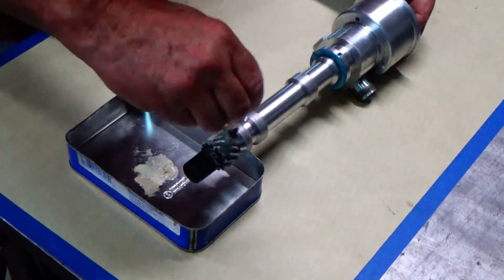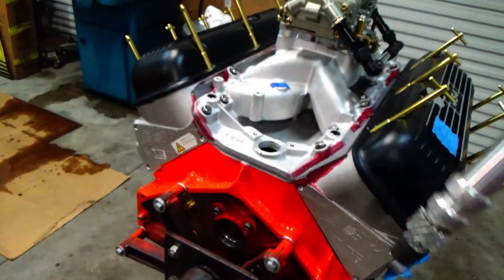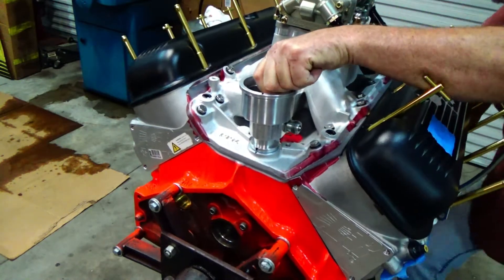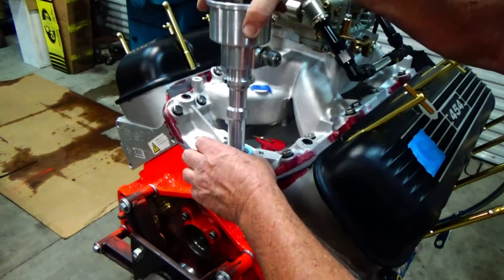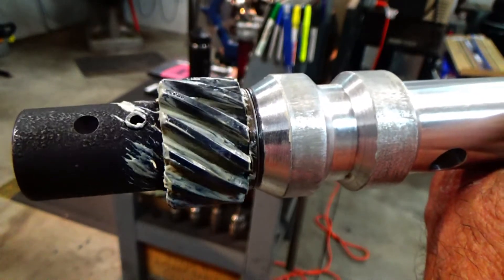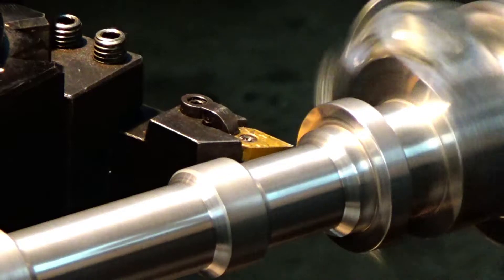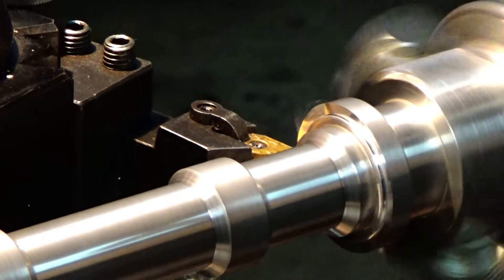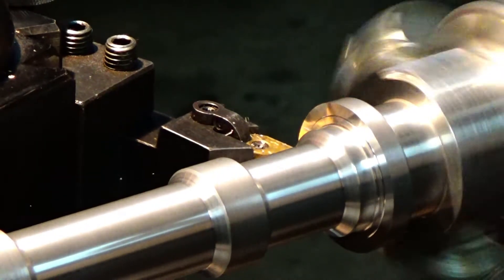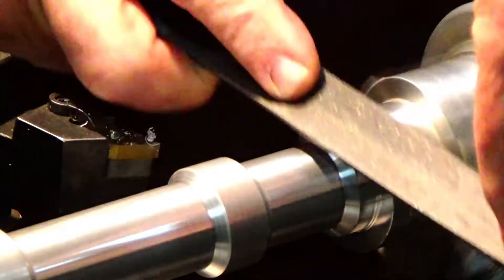Since I'm interested in the gear mesh, I'm going to use some lithium grease, stick it in the engine, hold back on the distributor, crank the engine over with my wrench, and see what pattern we get. It's not as bad as that other gear, but it's still towards the lower end. So I'm going to chuck that thing up in my lathe — since it's not a distributor that has a movable collar, I'm going to machine some off of it so it'll sit a little deeper into the engine and mesh with the gear a little better. I'm not going for perfect, but better than it is.